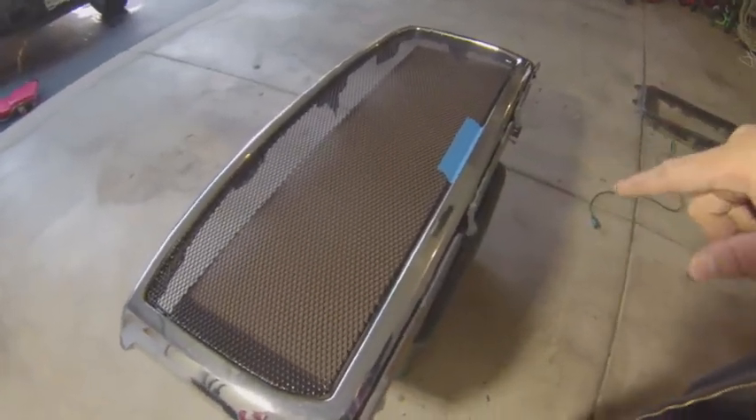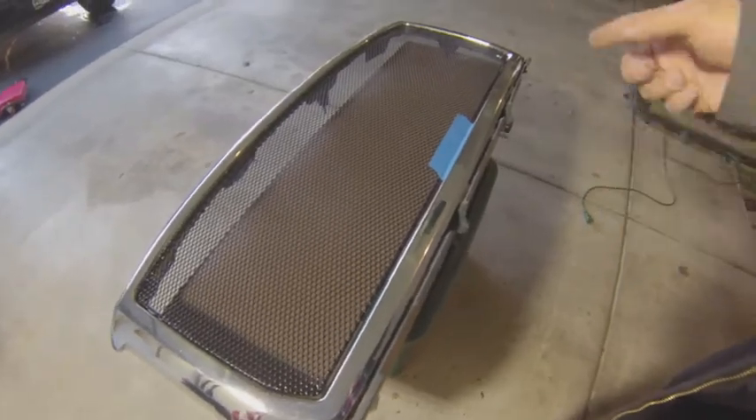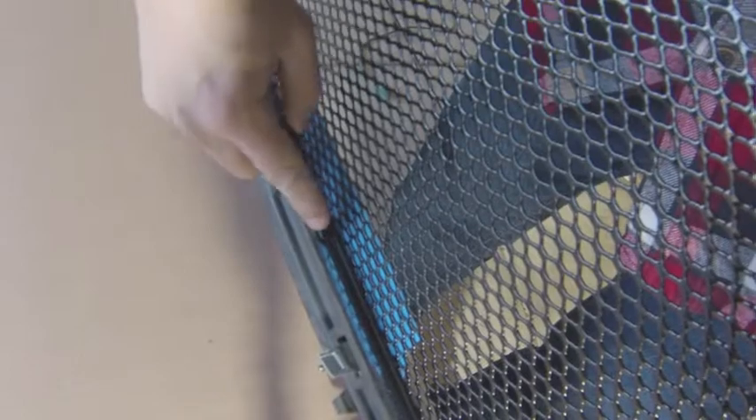This is really hard to do one-handed, so I'll give you a rundown and then show you the result. For the top and bottom tabs, you want to push them as far back to the edge of the chrome as possible. After those are mounted, you can go back and adjust the depth of the grill using the side tabs. Mount all the bottom screws as far back on the chrome as you can, same thing with the top, then go back and do the sides.